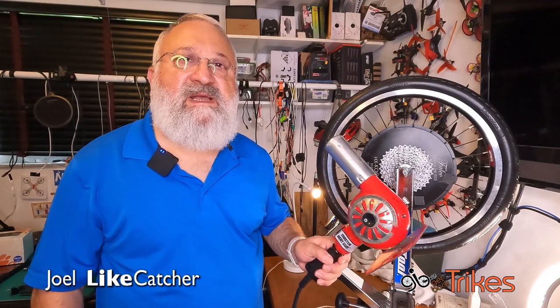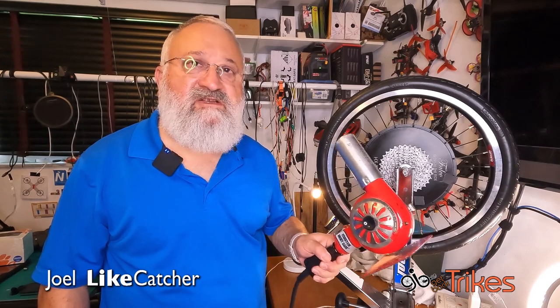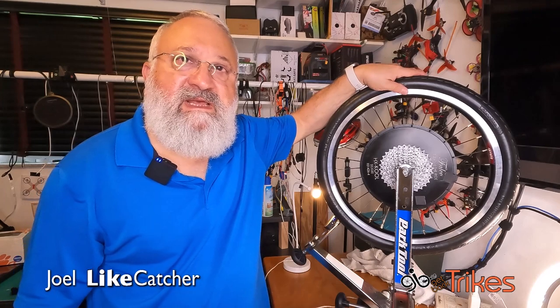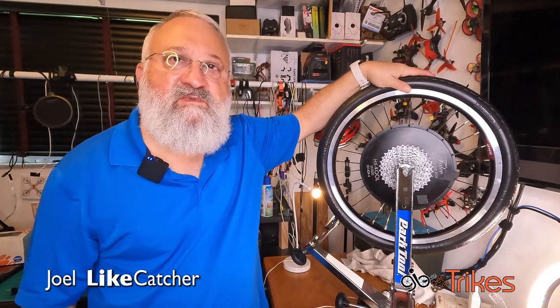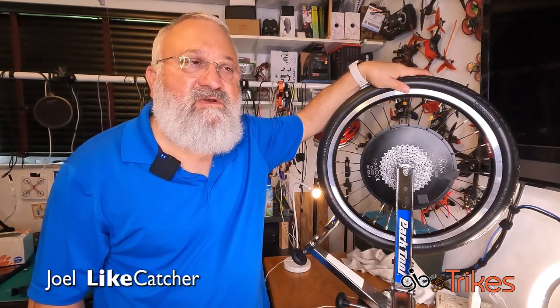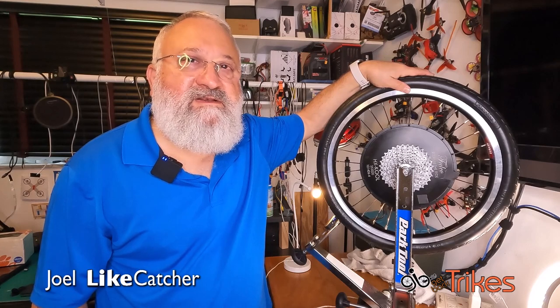An important question is, how hot can I make my tire? The answer is, if it's too hot to touch, it's too hot. Because you have to be able to hold it and manipulate it. And quite frankly, I haven't found getting it hotter than you can reasonably and comfortably touch to be important. You don't need to get it so hot that it's going to melt.